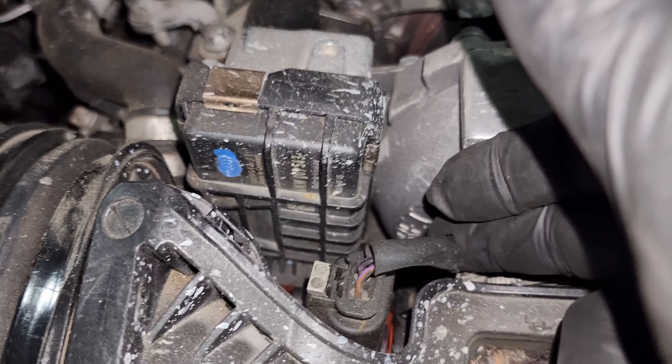As you can see back here, this is the tube that came out of the back of the intake manifold. When doing this job, there are a lot of parts that get replaced. If you're interested in what part numbers are going to get replaced, look up the diesel recall where the intake manifolds get replaced — it's all of those. Next, you're going to want to remove the intake ducts from the left and the right. You've got one on the passenger side, one on the driver's side. It just unclips from right here — lift up like this, pop it up with a pocket screwdriver, then pull it out down from the air filter.